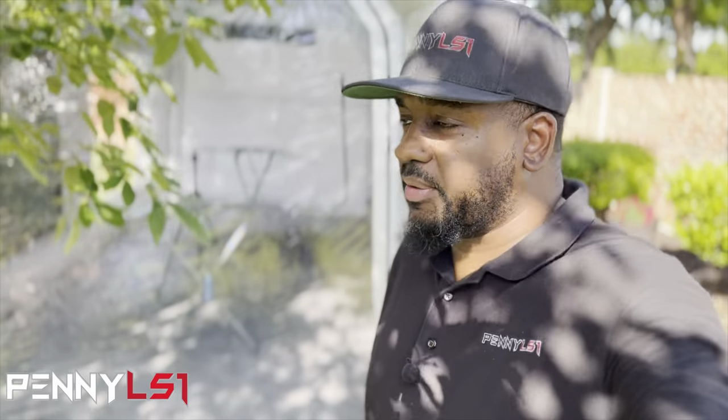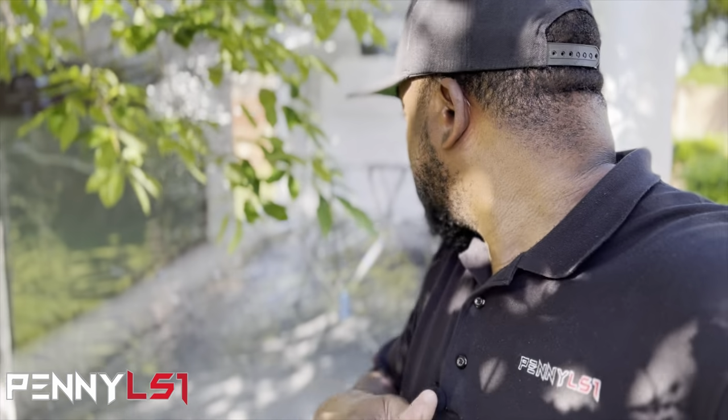All right, so we got everything sprayed. We'll go ahead and put everything up. I got 2 coats of satin black on the window trim and the lower windshield piece. I went ahead and 2K primered the airbox top. It has some divots in it, so I'm going to try to body work that out. We'll probably shoot that next weekend. I'm going to try to get some color on the inner fenders and shoot the white pearl and see what that looks like.